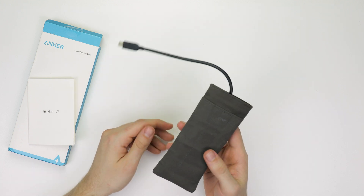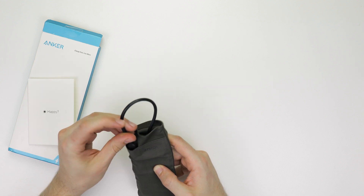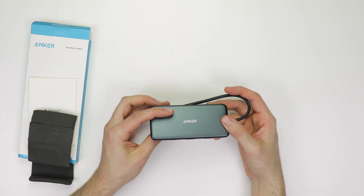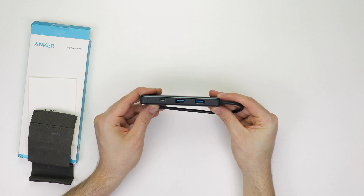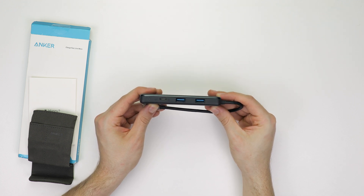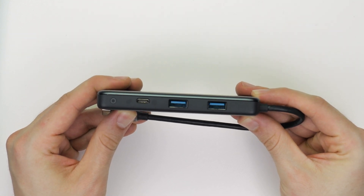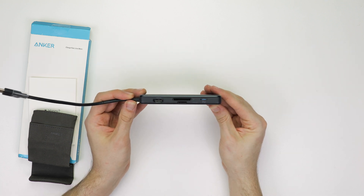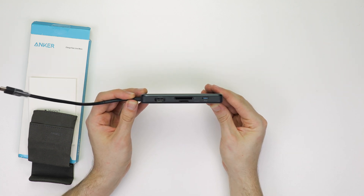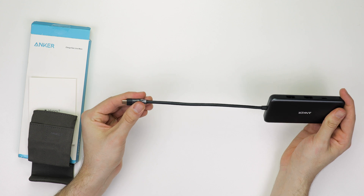This being a 5Gbps USB-C hub, almost all ports will be limited in comparison to the previously shown docks. There are three USB data ports altogether, and all of them are 5Gbps — two USB-A and one USB-C. There's also an LED activity light on this side. On the other side of the dock, we have a 100W power delivery port, and next to that are dual SD and micro SD card slots. There's also a single HDMI video port capable of reaching 4K 30Hz.